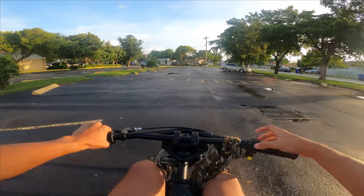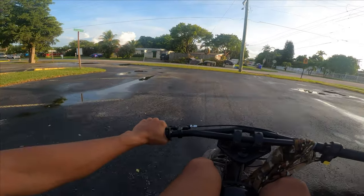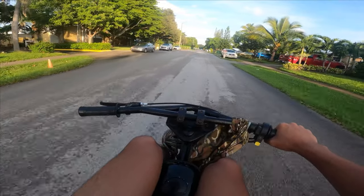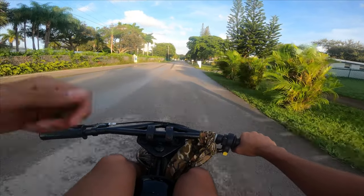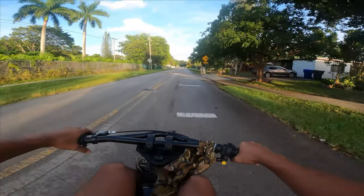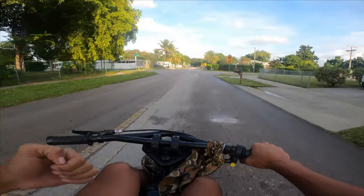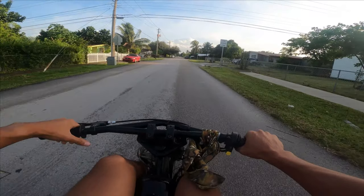But so anyway, back to the topic of why this bike is four-stroking. This bike is four-stroking because I've been riding it around, and there was a time where I ran out of gas at a friend's house, and I really needed gas to get home, obviously. And I told Eddie, my brother, if you guys don't know, to bring the gas and the oil, and I'll go mix it up. And I was in a heavy rush, and I just threw in, I don't even know how many ounces of oil into the gas mixture. And the gas was already under like the 2 gallon mark, and I just forgot all about that. I just dumped oil in it, and I always dump a little bit extra than what I think it would be, to be sure and not blow the motor. And well, I think I dumped a little bit too much, because if we do a pull right here,